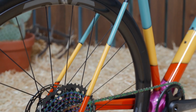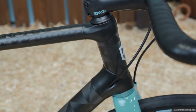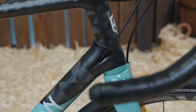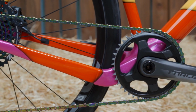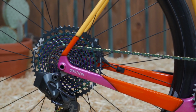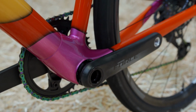It's obviously disc brake only, this platform, and utilises our 3D printed titanium lugs throughout and filament wound carbon fibre tubes. Differing to our normal road model, this Crossroad has a highly dropped drive side chainstay to generate that tyre clearance and chainring clearance that you need on this size tyre, but still maintaining really high torsional stiffness through the bottom bracket and the down tube through the bottom bracket and through to the chainstay area.